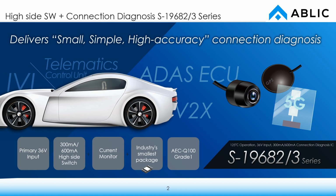You can use it to improve safety with a simple circuit configuration by detecting connection errors such as broken wire, short circuit, etc. and for ADAS ECU downsizing. It is perfect to detect and solve connection problems in ECUs that communicate with automotive cameras and antennas. Its compact design supports the demand for increasing the number of cameras.